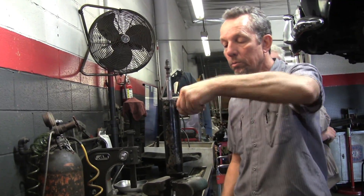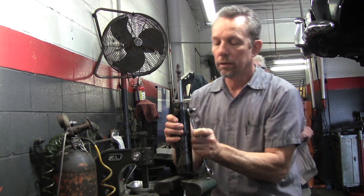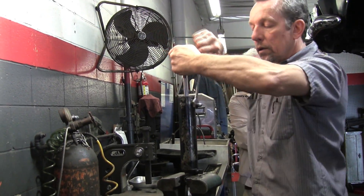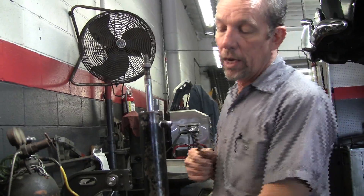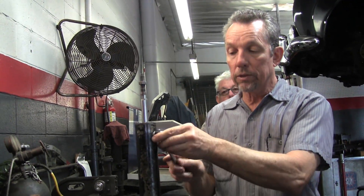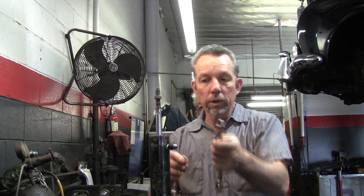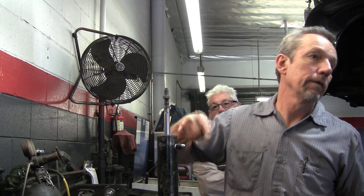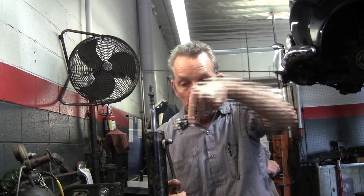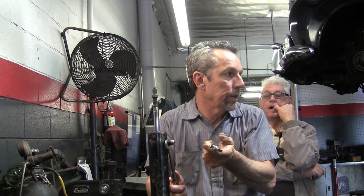There are two fittings — hold the bottom ones. This doesn't have to be that tight; all you need to do is crush that seal. It's pipe tape, so I don't know the torque spec on that either, but it's not real tight. The key is, if you've got those threads all sealed up, it shouldn't move. When you're tightening that other fitting and it bottoms out and you tighten it some more, that hose is going to back it off and then that's going to leak. So when you're tightening a tubing fitting, you always use both — hold the bottom one, don't let it move, then tighten until it gets a fresh feel.